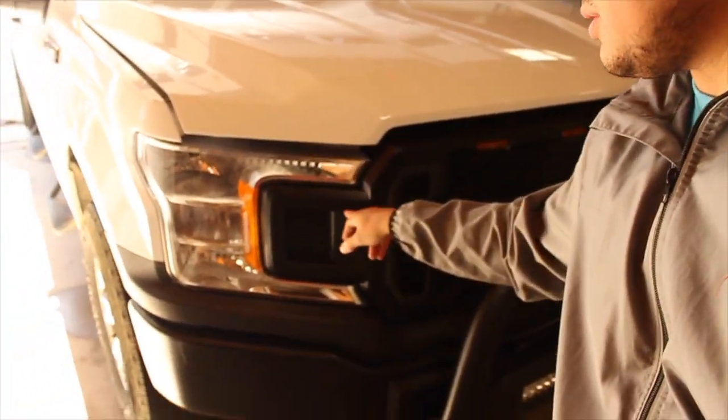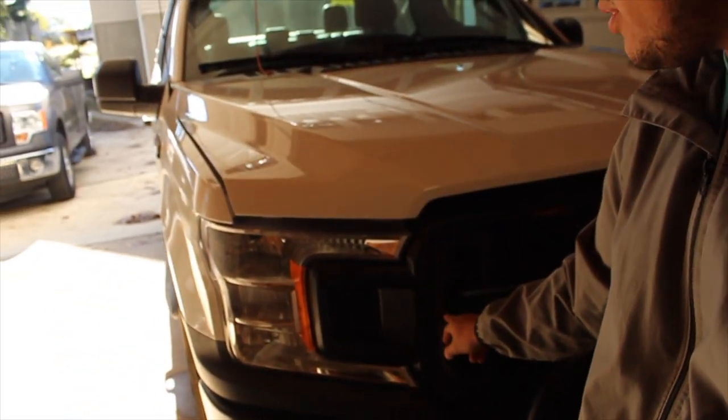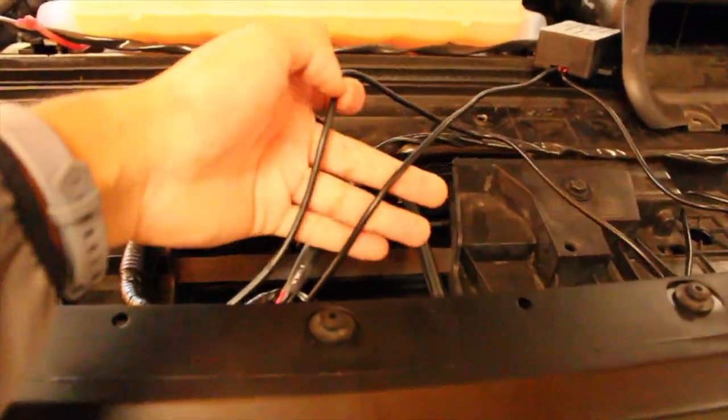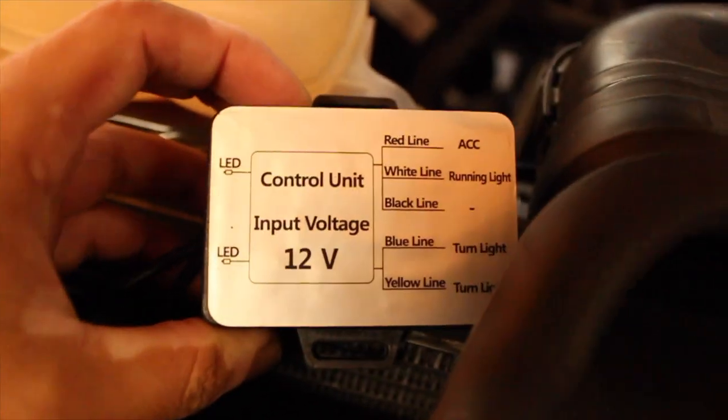We did get a good chunk of the installation done. There are a few things left that need to be addressed, mainly tapping in from the turn signal cable into the headlight wiring harness so that whenever I turn on my turn signal, this thing will be flashing amber just like my turn signal here. So we got this one going in for the top amber grille lights, and then we got these two that go down and hook up to either side with their own little connections. These go into the little control unit box, and these wires flow underneath the air intake and connect down into the headlight wiring harness.